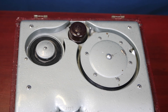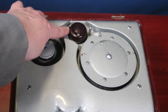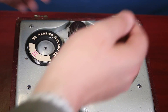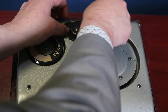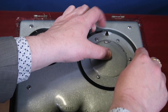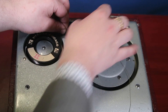Let's go through how to load the machine. First, you take the take-up spool and turn it until the playhead is at its highest position — the playhead actually moves up and down during playing and recording to distribute the wire more evenly on either spool. Once it's at its highest position, you take your wire — factory fresh spools have a little piece of thread at the end for starting. Pass it through the slot in the front of the playhead, then over to the take-up spool through the notch. Press the button in the middle to lift the little latch, feed the wire underneath it and let it go — that pinches it into place. Then back everything up until it's tensioned and you're ready to play.